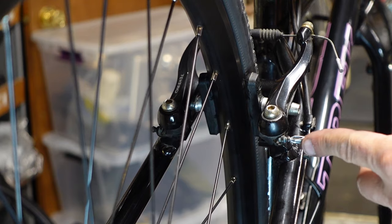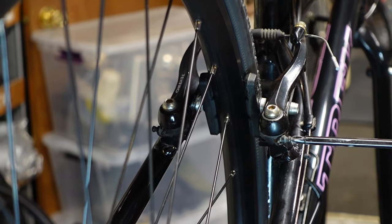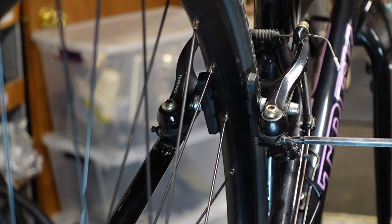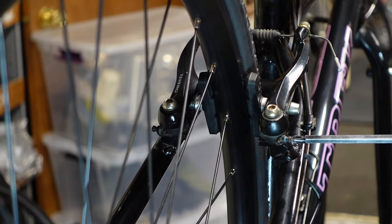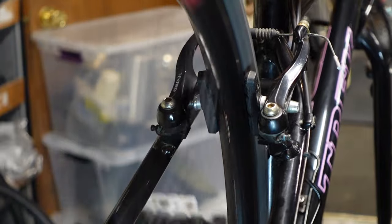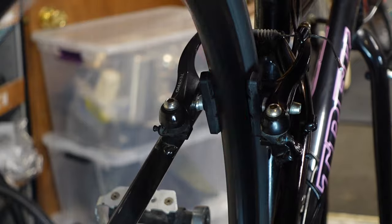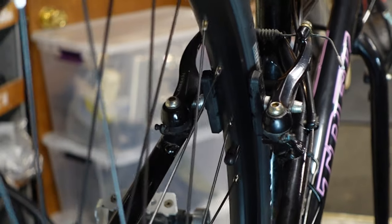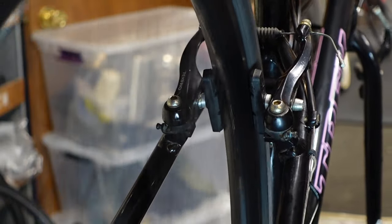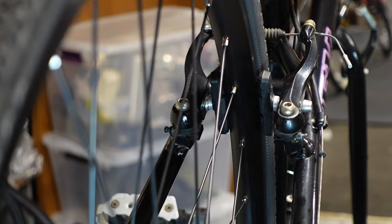So these little screws here adjust the linear springs. I'm gonna back this one off a little, and you can see it's pulling a little bit more from that side now. Now that's nice and centered. We're not getting any more rubbing. Oh man, but it sounded like it wanted to squeak. So much for my spidey sense. I'm gonna see if I can ride that out in the test ride.